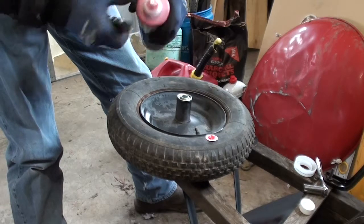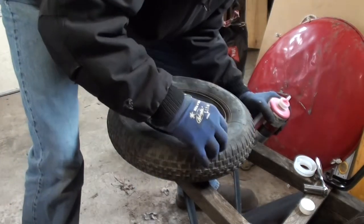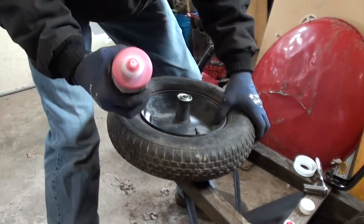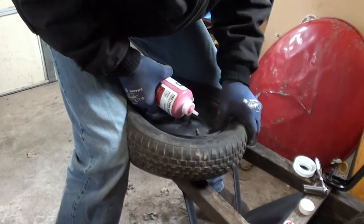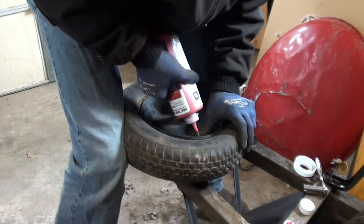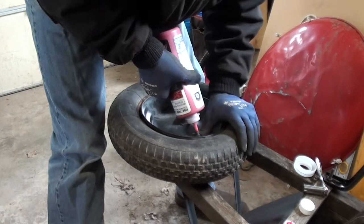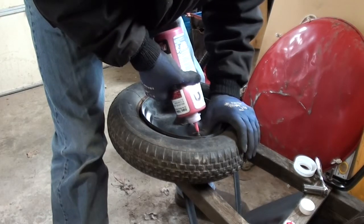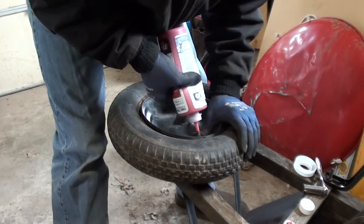That short hose is so that if you're trying to do this on a vehicle, you have a little more flexibility — put it over the top of the valve stem and then you can squeeze it in. Since I've got this one off and it's horizontal, I'm not going to do that. I will carefully cut the tip off with a pocket knife so I can get it into the valve stem. Keep in mind, even though this tire is flat and has the core out, there's still air in the tire. As you try to push this in you'll generate pressure, so squish the tire down before inserting the bottle — then as you begin to squeeze it in, release the tire and it will actually help suck some of this in.